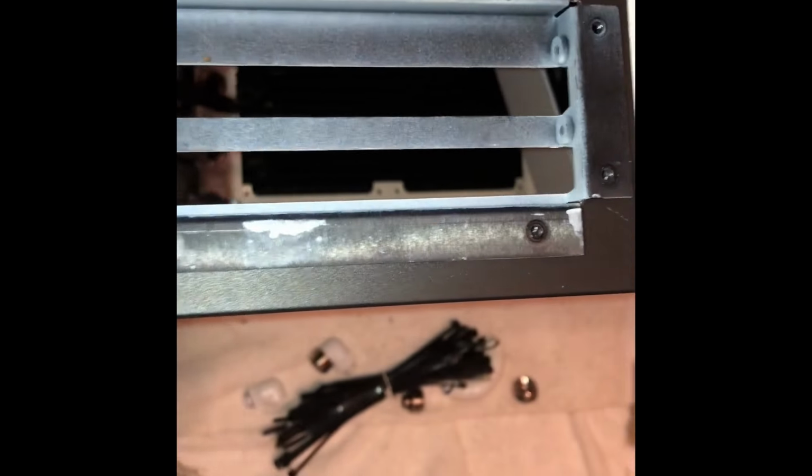One GPU installed. Now what I did was go and buy a bag of screws. Pardon the stickers on them. These are Micro Center salesman stickers in a way. StarTech, a bag of screws, 6-32s, 5/16 long. The length is irrelevant. Well, these are actually probably long enough, but you want to make sure they're long enough, but they're 6-32 screws.